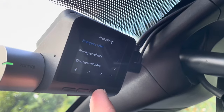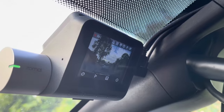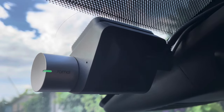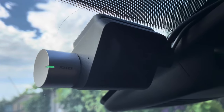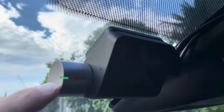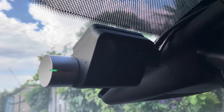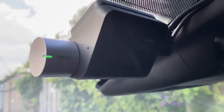Now when we turn off the car and the power turns off, this dashcam goes to timelapse mode, as I have timelapse activated as well, and the parking mode is activated as well. As long as it has enough power, this little light will stay green. When it goes to battery saving mode — that's below 11.8 volts — then it turns off completely, but the parking surveillance mode will stay activated.